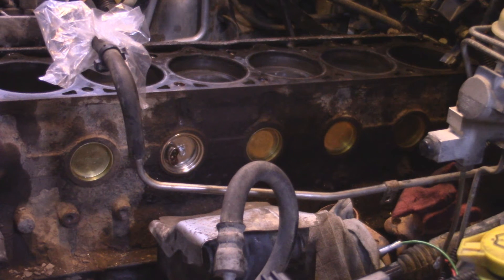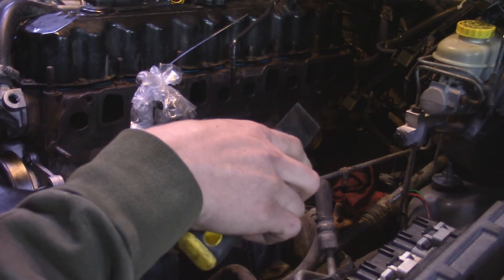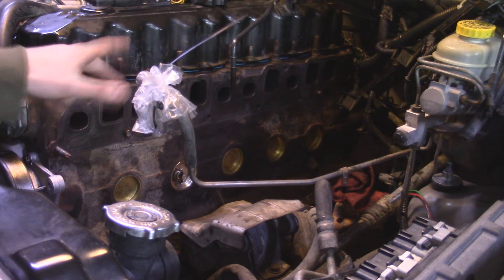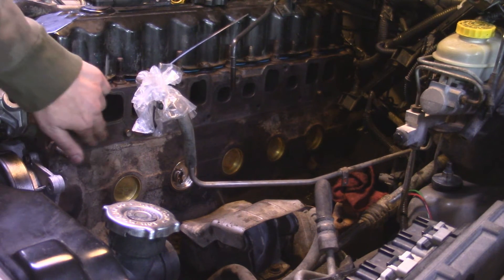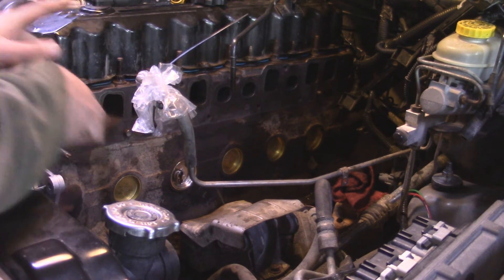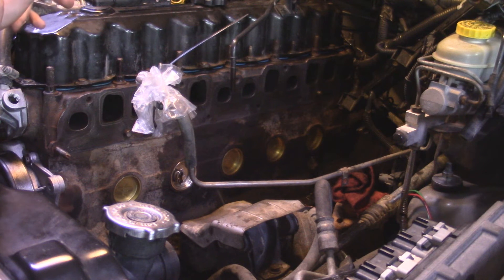Now that we've got all the freeze plugs in place, we can go and put everything back together. I've got to put the new head gasket back on, but if you don't, we can start by putting the exhaust manifold back on. I'm going to start off by putting the bottom radiator hose back onto the water pump. Before putting on the exhaust header and the intake manifold, we want to make sure the surface — both on the intake manifold, the header, and the head — is clean from the old gasket. To do that, I'm just using a putty knife or any scraper you have. Make sure you get all the old gasket off and then clean it with brake cleaner, acetone, or something like that, so it's nice and clean for the new gasket to seat in.